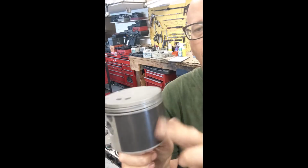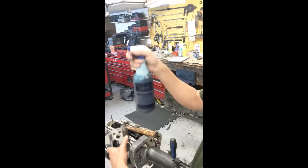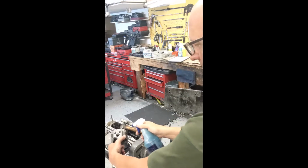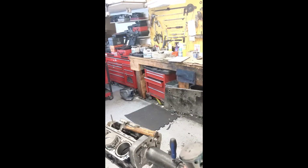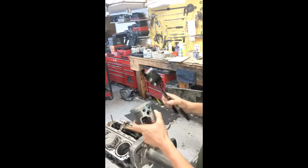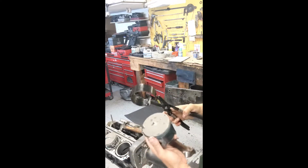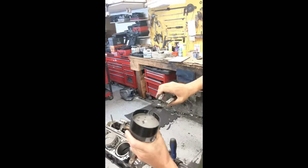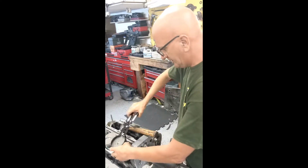There's already a little bit of lube on this piston, but we're going to lube it a little more. This is 2-stroke oil, just a regular bottle bought at Lowe's. And we'll spray it over the block because the block needs oil too. And we'll install our ring compressor. You can read that, it says bottom because it's got a slight taper to it. Remember, you're going to line up those pins. You can always rotate the piston a little bit. That feels good. Remember, up is up.